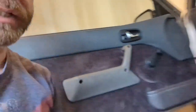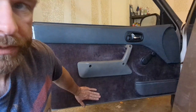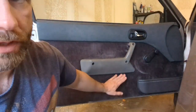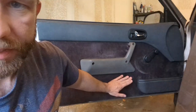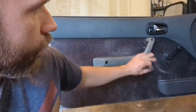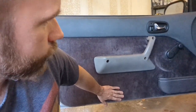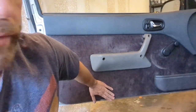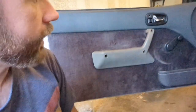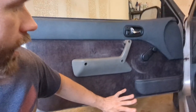Later I came back and took that panel I bought and picked up some corrugated plastic board — you can get that from Ace or a hardware store. I traced it, drilled the holes through it, took the little trim darts, mounted it inside the holes I drilled, and wrapped it with fabric. It actually replaced the panel with an aftermarket one that's much stronger and water-resistant, so you'll never have to replace it.